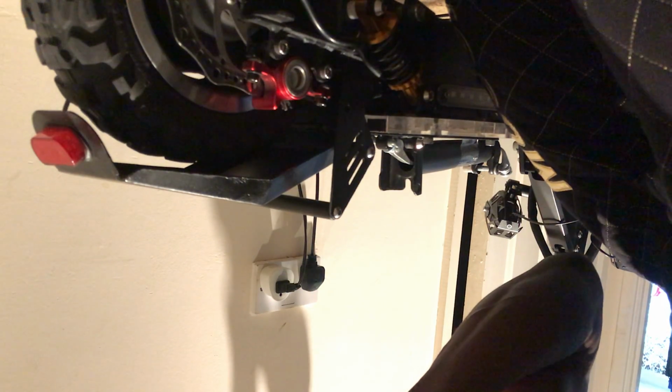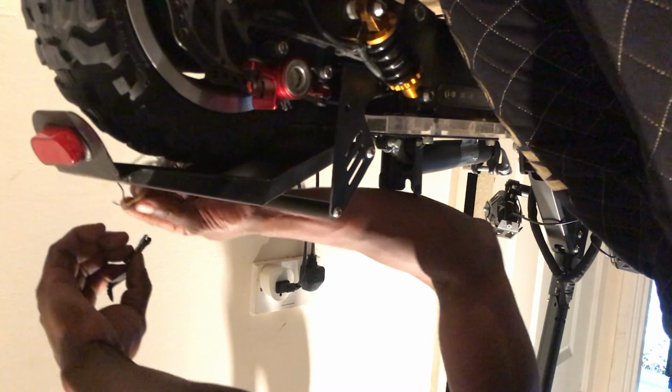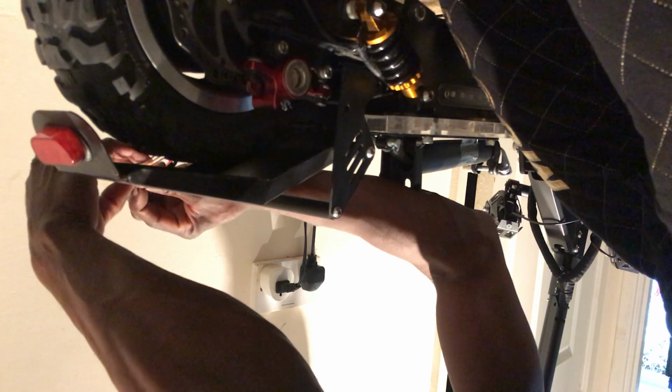At this point, you don't need too much. You can cut just a little bit like this and put it on that, so that way it's protected from touching the other ones. You put it on that and go all around it. Go to the left, don't just do the middle. Roll it a bit to the left and a bit to the right, so that way it doesn't move. When you do, put a little tension in, because if you do it loose, the insulation tape can move on the actual coating of the wire.